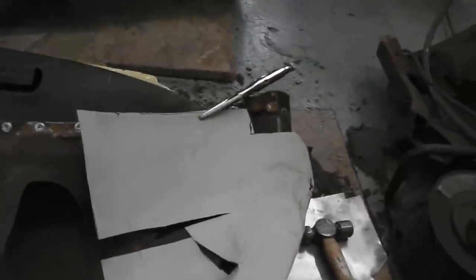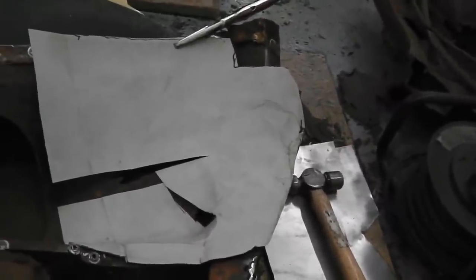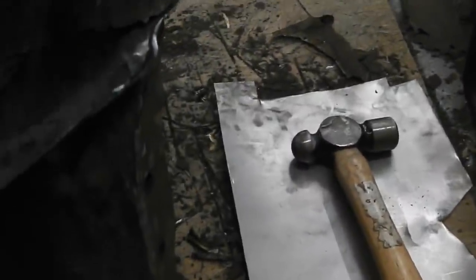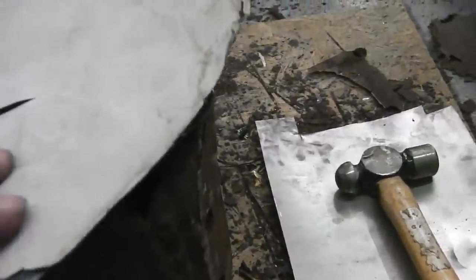It's actually, when you think about it, it isn't that complicated at all, really. It's just making the pressings, but we're going to do that with the oxy flame. So we're going to heat up and there's just enough strength. That's a little bit weak, so I'll preform that right angle, so I'm not hammering this piece. But there's enough to hammer down onto that basin and we can get that shape there. You can see what they've done. So that cardboard gives us the metal that we need. This is dead easy. We just whack that round. You'll be able to hammer that red hot and make that shape there. So that's not a problem. It was all about getting the template cut the right size.